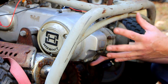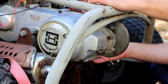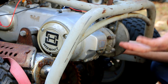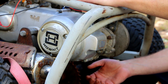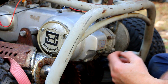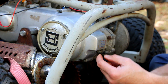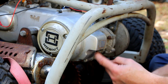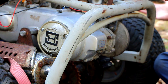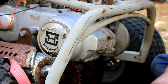When you stop running the engine and it cools off or weather conditions change, if you don't have a way for air to go back in through the vent, air wouldn't be able to go back in and as it cools it could actually create a vacuum — and that would be bad too. So this basically is just here to keep the pressure equalized inside the case as the oil expands and contracts. You actually only fill the oil up to where this bolt is. There's no dipstick like on an engine — all you do is take this bolt out and put oil in through here until oil starts to run back out this hole, and then you know you're at the proper level. Of course you've got to have the vehicle on level ground.